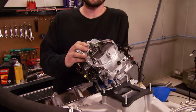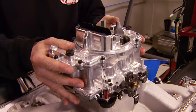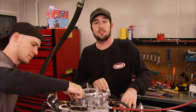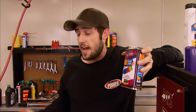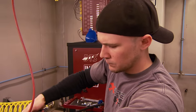To feed our Olds, we're using a Summit 750 CFM square bore four barrel with mechanical secondaries and a manual choke — the same carb we used on our 464 a while back. A lot of questions have popped up about wear protection in engines, especially during flat tappet cam break-in. The EPA has determined that ZDDP and phosphorus in motor oils can destroy catalytic converters, so those levels have been reduced. The downfall is phosphorus and zinc are the two main active ingredients in oil that fight wear protection, and without them it's extremely fatal with flat tappet cams and lifters. Since we're working on an Oldsmobile, Joe Mondello wants us to run his special formula additive in the motor oil so we know we're going to have a safe break-in.